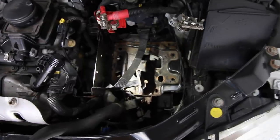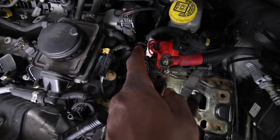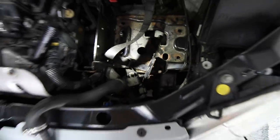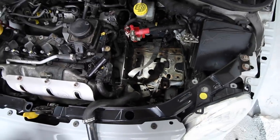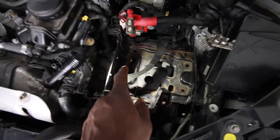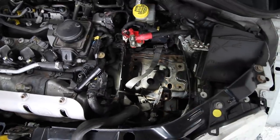To give you a little update: you need to remove three bolts - one here, one here, and one in the middle. You then have to unclip all the wires connected to this battery box, then unclip the return pipe that goes to the air filter. Once you unclip that, it releases the battery box, which allows us to get to the cable underneath. It's nigh on impossible to get to that connector without lifting this battery box out of the way, so three bolts, unclip all the cables, and we should be good to go.